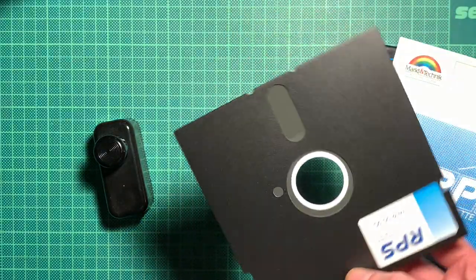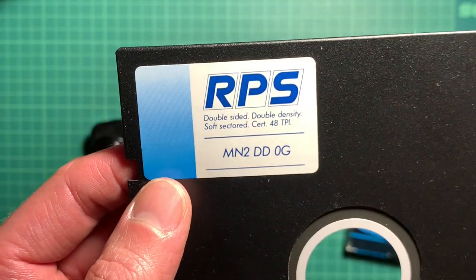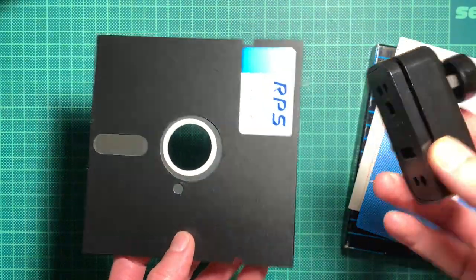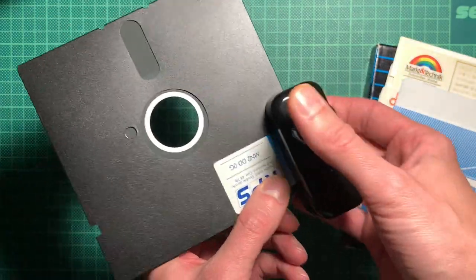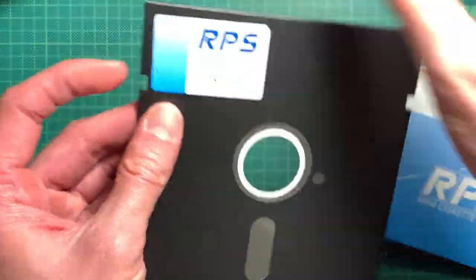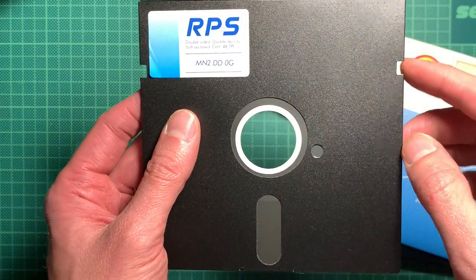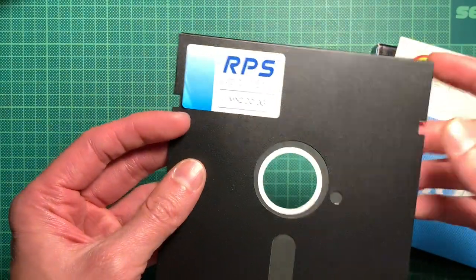This is actually a double-sided double-density floppy. For the C64 it's possible to use a hole cover — put it on the left side of the floppy and punch a hole here. On five and a quarter inch floppies, if there is a notch you can write to that side. The write-protect hole is always for the side facing up, so if I turn this around and there's a hole here I can insert the disc the other way into the 1541 drive and write the second side, which I did.